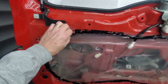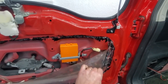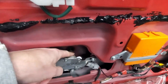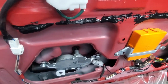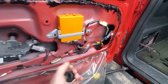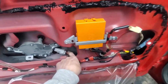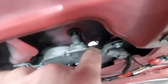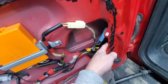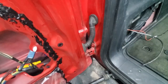Once you've got that part, you'll need to un-goo the plastic from the sticky adhesive — mine has been off before so it comes off kind of easy. Then you've got access right through there to where the grommet comes out. I needed to open this up because I forgot to put the grommet back on, so I needed to unplug the plug, put it through the grommet, and route it back. I just came from the hole right back there — that's where this grommet goes. The wires come in there, I brought them out here and along here, then you've got to snake them through — that's not super easy, but if you work at it you can do it.